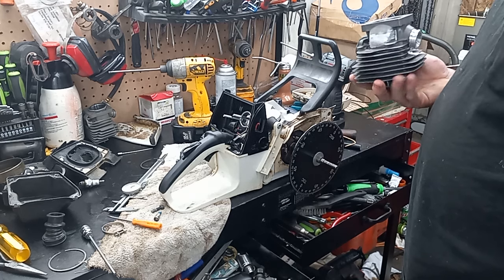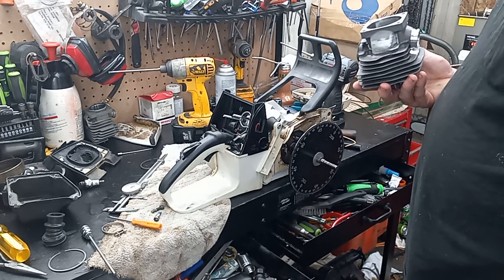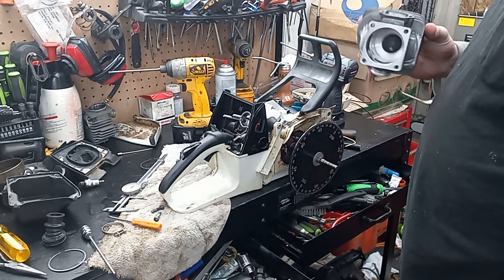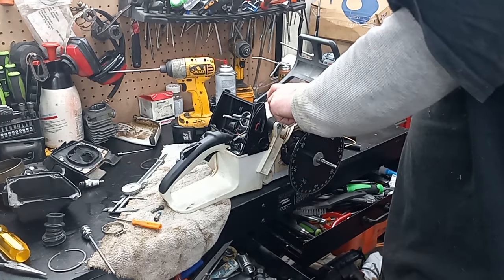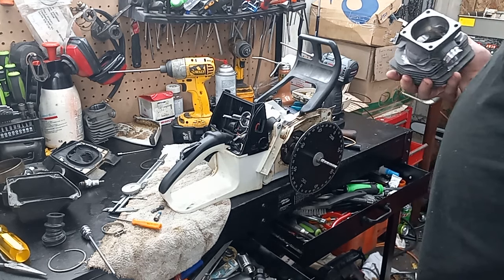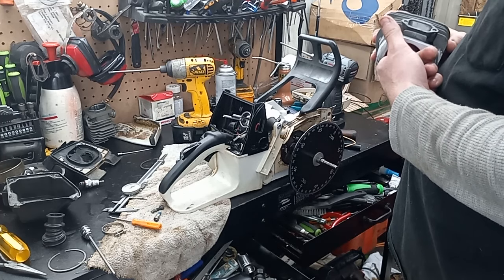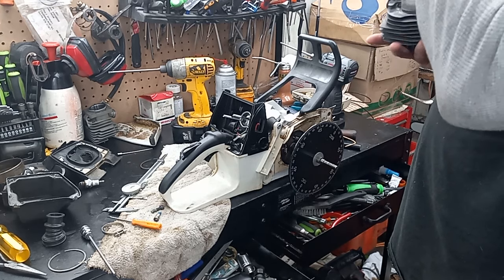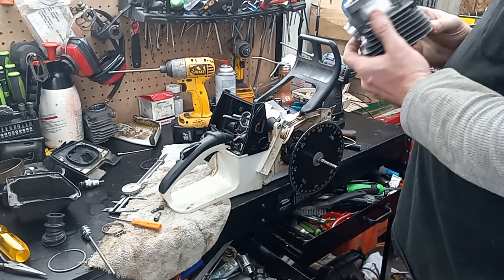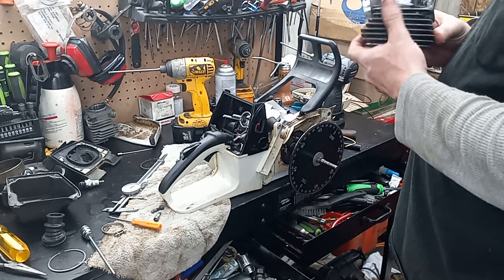I think I'm going to move it to 80 on the intake, maybe 78. I think I'm going to move it to 96 on the roof, and around 116–117 on the transfers — going a little more duration. I did cut a button top taper in this, but with the way I've had to machine everything, this piston's sticking up quite a ways inside that exhaust port and I just don't have enough port area to let it breathe. So I'm going to give it more duration and more intake to feed it a little more.